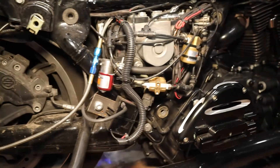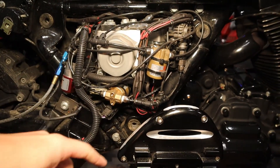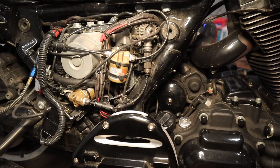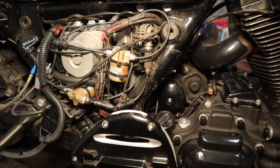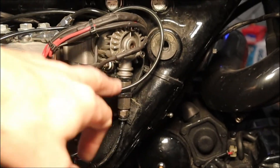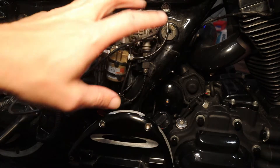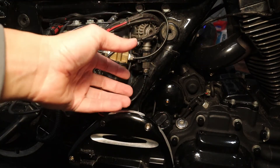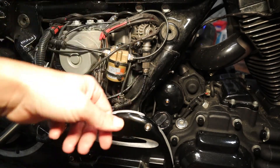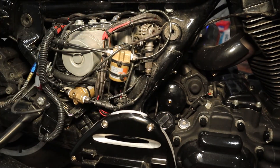So you can see the airlines are all running through here as well. Here's all the airlines from my front and rear — the dump valves and fill valves and so forth. Pretty cool how it's all tucked up underneath there. The air compressor's in there too. If you could see it right up in here, I had to cut away some of the ABS tray. That's that part of the tray — it's not used in the United States; that's for emission control systems in Europe. So in the United States, we use it for our air ride system.